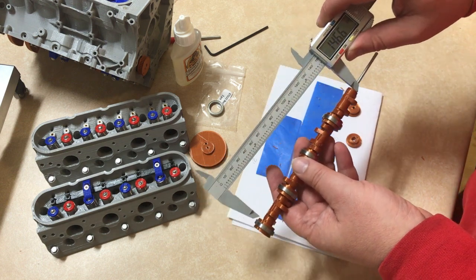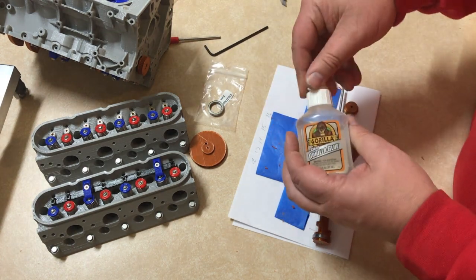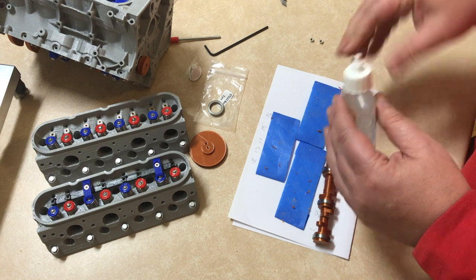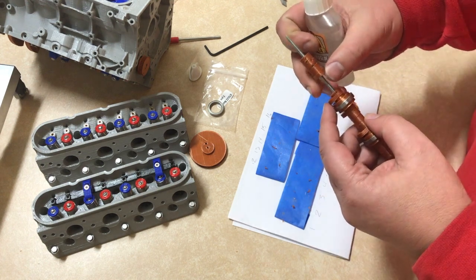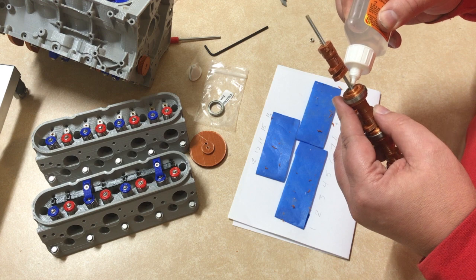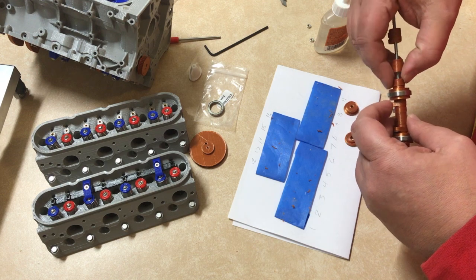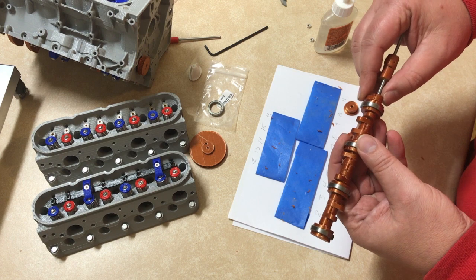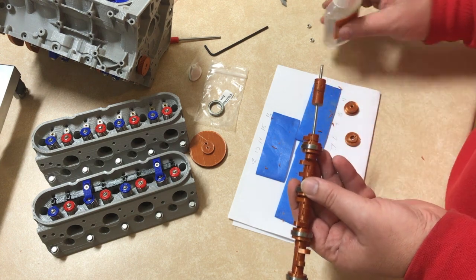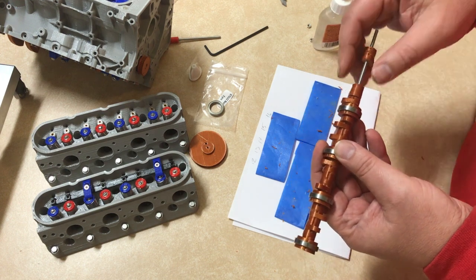I've already sanded these down so it did match — 146.7 millimeters I believe. I used Gorilla Glue to glue them down; it worked pretty good. It sets up in a couple hours but then I let it dry for 24. To make sure you're gluing it right, there's a line printed in each of the lobes that you line up down the entire camshaft to assure that all the valves will open and close at the appropriate time. This is another reason why you don't want to glue it all at the same time. You can kind of see the line right there across the first three sets of lobes, and I'm gluing the next set at the same line.